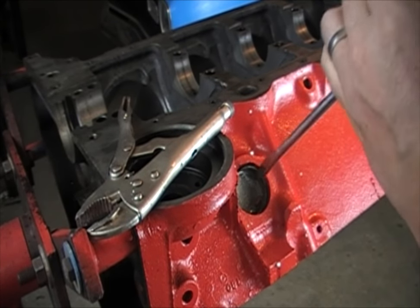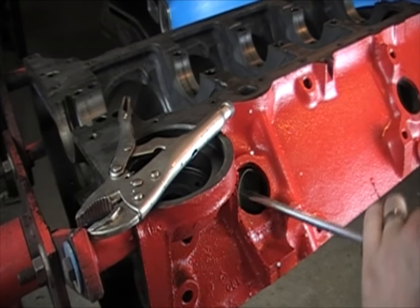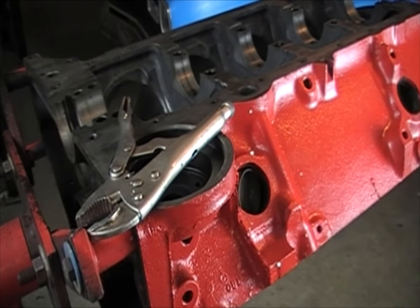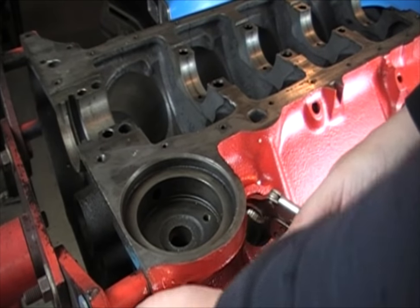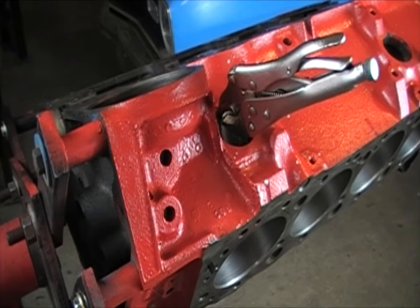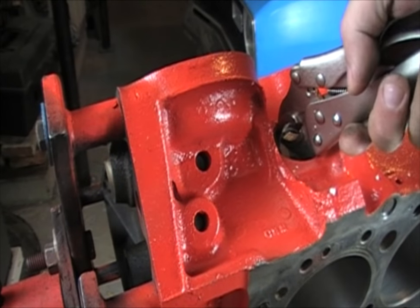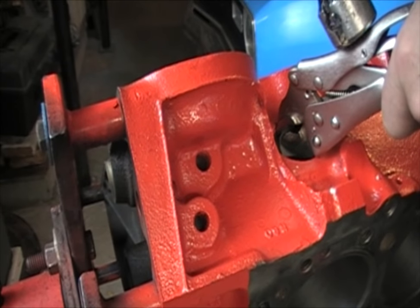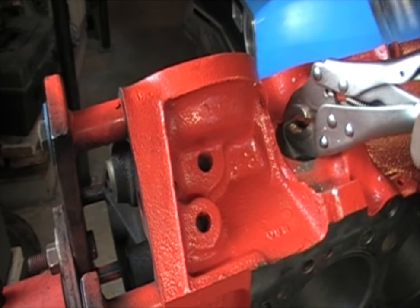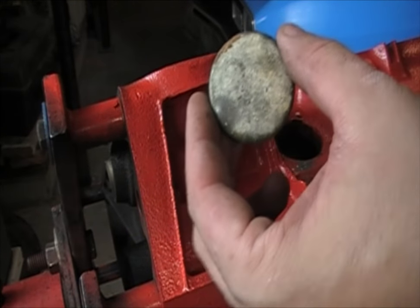If that doesn't work, you'll know you're hitting the cylinder, so you'll want to come over to the other side. You want it to flip up on this edge, kind of like that. Once you've got it to that point, take your vise grips — this makes it a lot easier than having to fish it out. Then take your hammer and just tap, not bang hard, but just tap right here on the vise grips, and that'll pull it right out. That's how you get the side and the two front plugs.